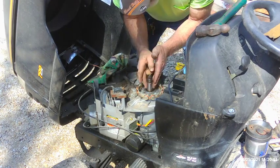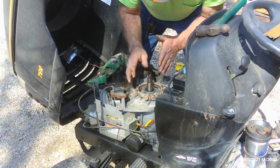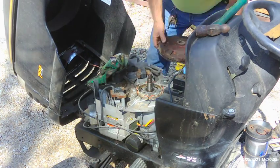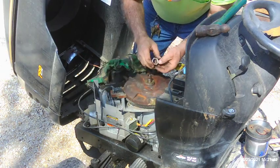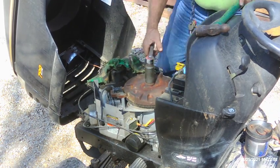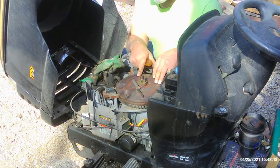I have to admit it did not appear to be sheared, but I got a new key — I'm putting in a new Briggs and Stratton key just for the heck of it. I went ahead and took the time and blew all the dirt, filth, dust, and everything out from around the whole top of the engine. Let's see if we can slip this back on here. Got the flywheel pretty much tightened down on there.